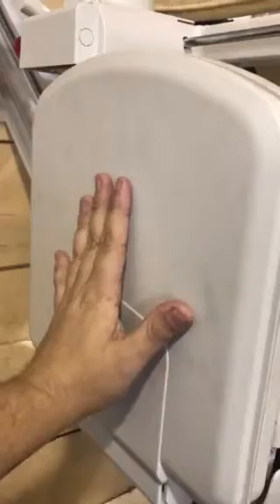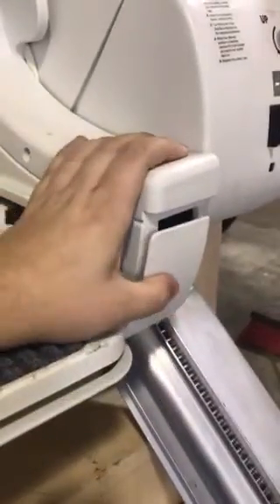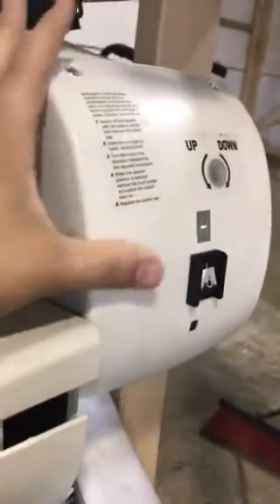The easy way to fix this is to toggle the safety edge. There's a safety edge on the bottom of this footrest — if they put their hand in the middle, they can actually toggle it back and forth. They're spring-loaded. Underneath the footplate there's usually another one — same thing. And on the motor itself there's one here, and on the back end, right there.